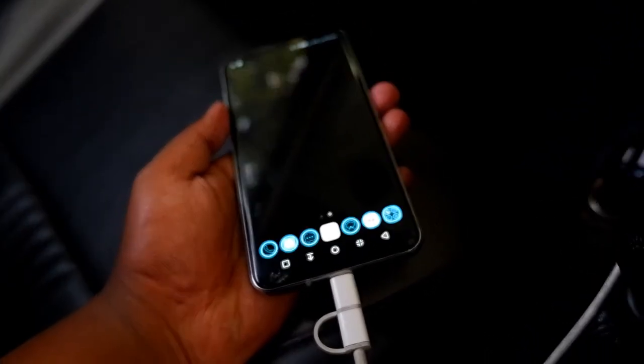Use the white color port that is present over here. That's the 5 volt 2.4 ampere port. So use that for charging your power banks, Bluetooth headphones or such accessories like smartwatches or something, and use the red color port only for charging your smartphones. I think nowadays upcoming smartphones are having the fast charging QC support. You can also charge your Samsung, it's a fast charger, adaptive fast charging, and also any other smartphones with quick charge, Qualcomm's quick charge technology, or any other smartphones that has support for 9 volt 2 ampere charging, 18 watt charging, you can use this one for charging them.